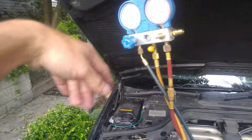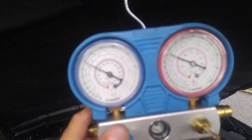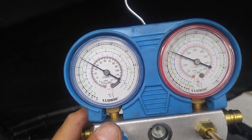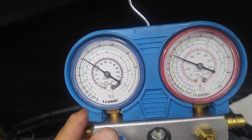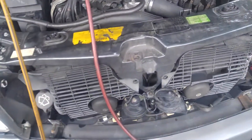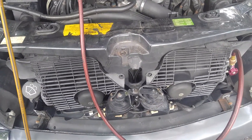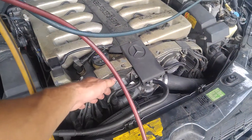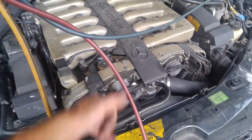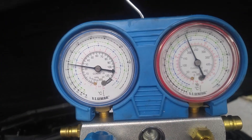Some people will say the low pressure is too low, or the high pressure is too low or too high — whatever. This is the Mercedes S-Class and this is how it works. I've seen a lot of these and the high pressure gets really high when it's hot, and the low pressure drops really low when it's not too hot outside. The fans do not even activate — as you can see the AC just kicked in, but the fans aren't activated because my mechanical fan is very strong.